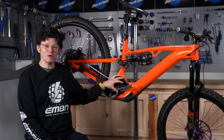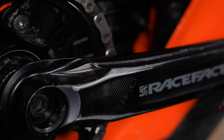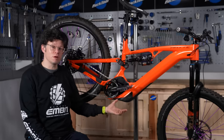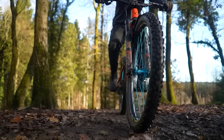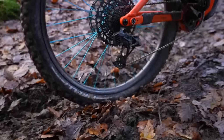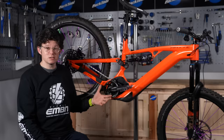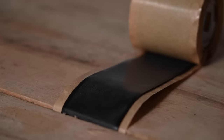On an e-bike, the motor and cranks are wider than on an acoustic bike, and that often means — especially if you're running flat pedals — you can rub cranks quite easily, especially as they're going to get covered in mud and crud flying up from the front wheel. Just be really mindful to protect them. You can get dedicated stickers to protect them, which are kind of like a hard plastic offering some protection — they're removable so you will need to replace them. You can also use 3M mastic tape.